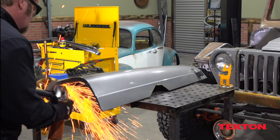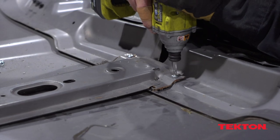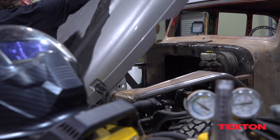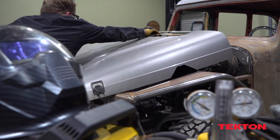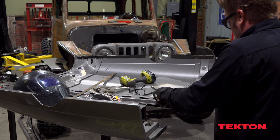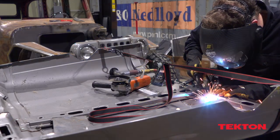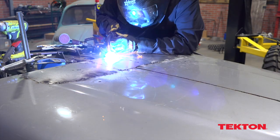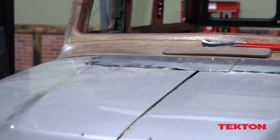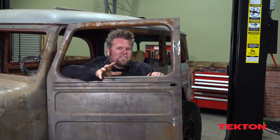One of the custom touches that's going to make this Willys wagon truly one of a kind is making the 2004 TJ grill and hood flow with the wagon body. That means narrowing the grill to fit the frame correctly and then making the pie cut hood match up with both the grill as well as the classic Willys body lines and work with my custom firewall. No easy task but it's gonna look good. This modification is common in the hot rod world - I'm basically trying to glue a hot rod together with a rock crawler.